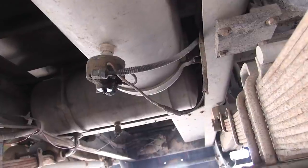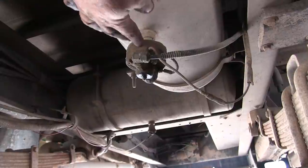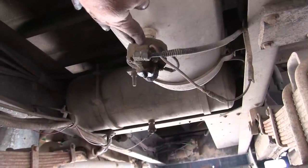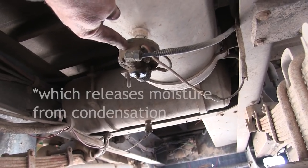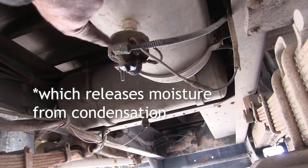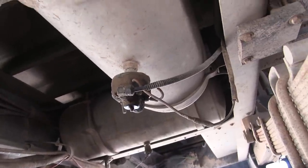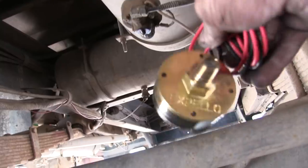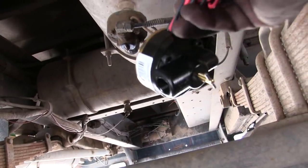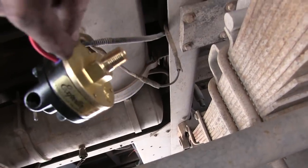So this is what we're doing right now, when you reach the unloading pressure, and that's when the bus goes, this one also does it. There's one that the air dryer does, and it sends a little signal to this one to do it too. Well, this one's all eaten up, probably because there was so much oil in the system. So now we're changing this one out, and I'm gonna replace it with, dun, dun, dun, dun, a brand new one, looks exactly the same. It's called an Expello, made by a company called Expello. So that's what we're gonna do right now.